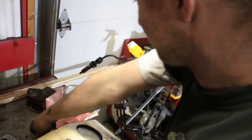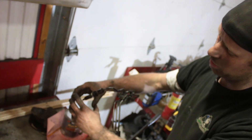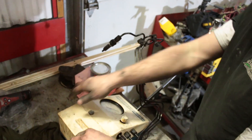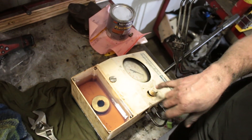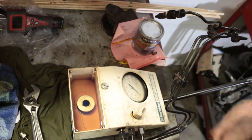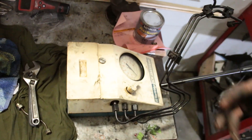Very simple — just put it on the machine and tighten it up. We'd want to spray this into a bucket where we can see the spray pattern but we're not breathing in the fuel. All this tester is is a mechanical pump. It takes fuel from the back, pressurizes it to up to about 5,000 psi, and will unseat the injector tip. This is just clean diesel fuel going through a filter with a little bit of ATF added to it just to lubricate it.